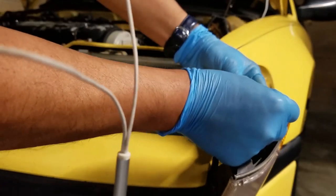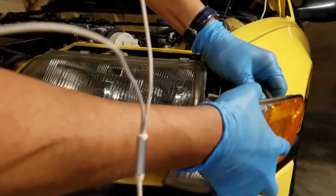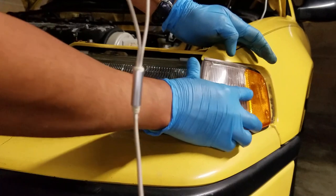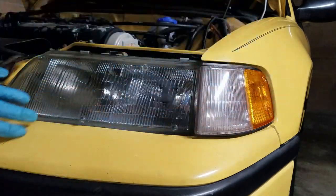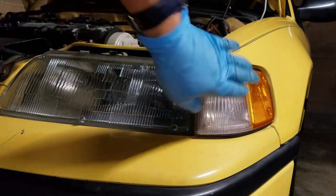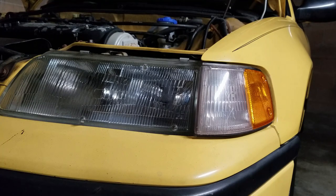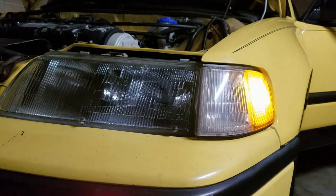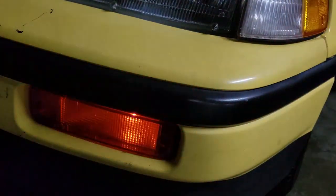Right in there - there we go. That's SuperBrightLEDs.com. SuperBrightLEDs.com gives you the type of bulbs that you'll need in order to replace your regular bulbs with LEDs. I want to keep the original housing, so that's why I'm just replacing the bulbs. I didn't pop this in all the way because I want to check if that bulb actually works. I'm going to turn the car on and turn on the left turn signal and see what happens. It looks like it's working, so I'm going to pop that back in. Now I want to change this other one.